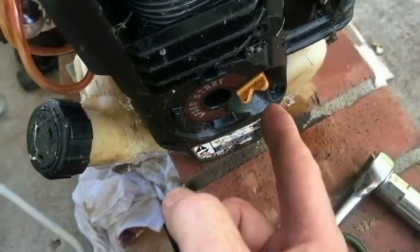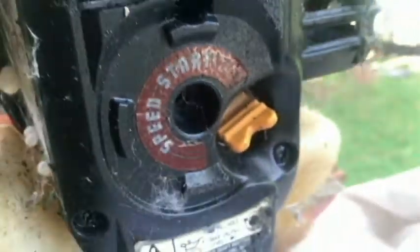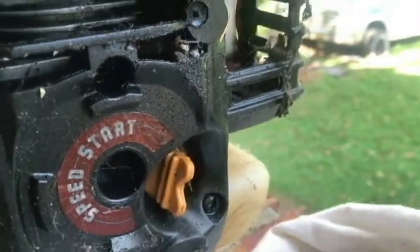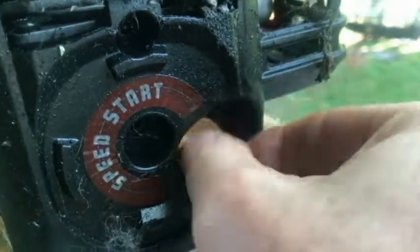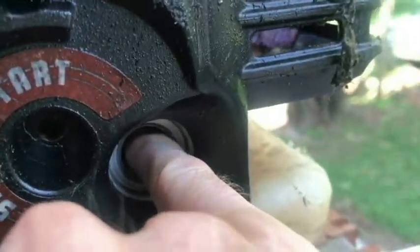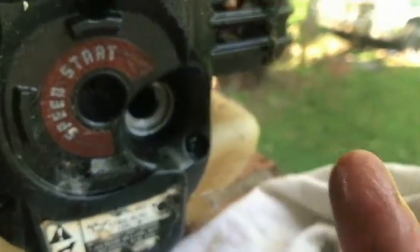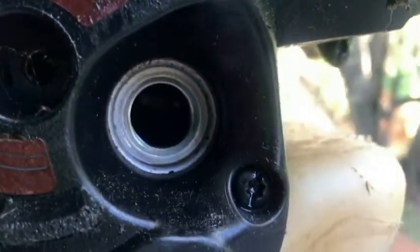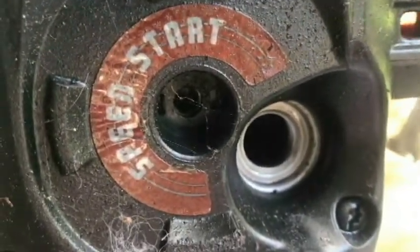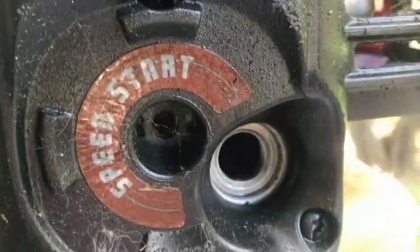Next, let's check the oil level. All right, so we've got the trimmer level. Good grief, that thing is tight. I don't think there's a stick, so we're going to have to just feel. Yeah, okay, so I'm just barely moving my finger down and I'm touching oil. So ideally the oil should be just coming out a little bit. I think it tells what kind of oil maybe. I don't have the manual, but I can find out for us. But probably good enough to start it up.